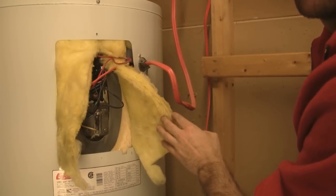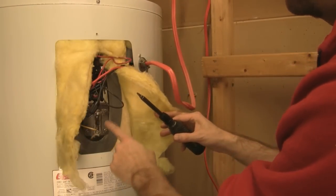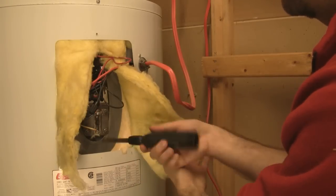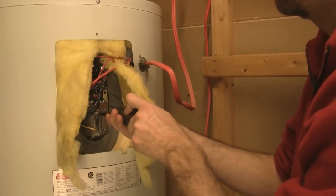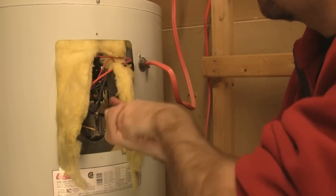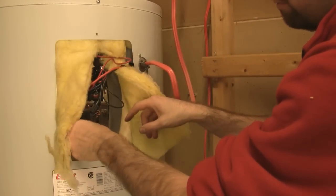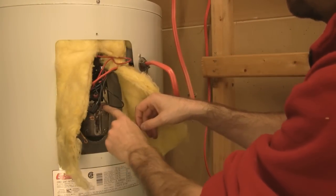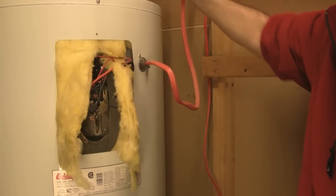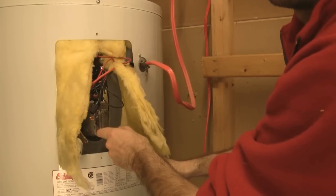I've let this cool off a bit and I've moved the camera around so you can see what I'm about to do. I've opened up the insulation so I can access the element. I'm going to first undo these screws so that we can release the power. Once I've taken the screws off, I'll bend those wires just a little bit out of the way, then loosen these four bolts and the heating element should slide right out. This particular socket size is 9/16ths, but use whatever fits for you.